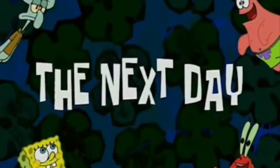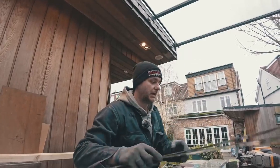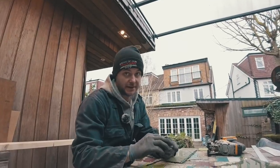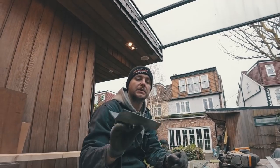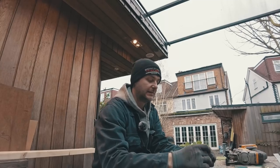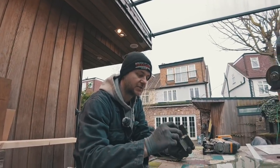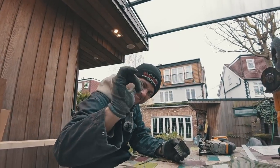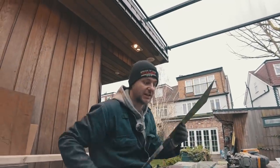That's a diffuser. The next day. The center section fins are all pre-cut. I also made L-shaped brackets, again carbon fiber. Simply used a metal profile for the shape, and then about 8 layers of carbon. So they are super, super thick and super rigid.